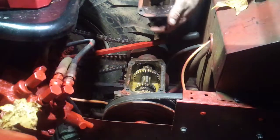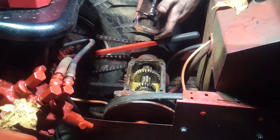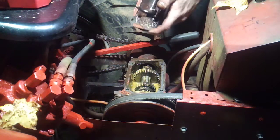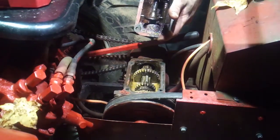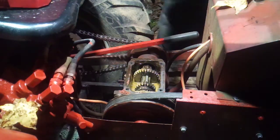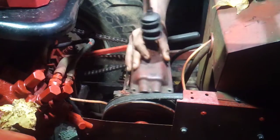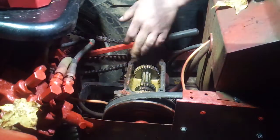Normally you would clean up these mating surfaces on both sides and put fresh gasket maker in there — or a gasket if you can find the right kit — and get it to seal right. My gearbox does this enough that I'm in and out of here quite often because I don't have access to a welder to do this job. Always remember the side with your gear shifter goes on the side of the chain.